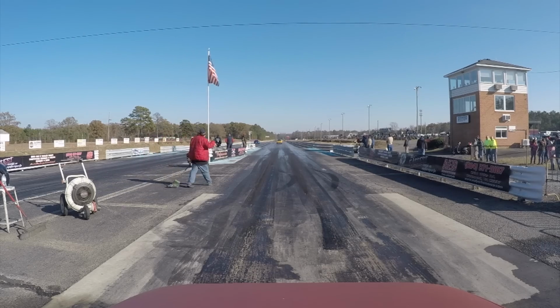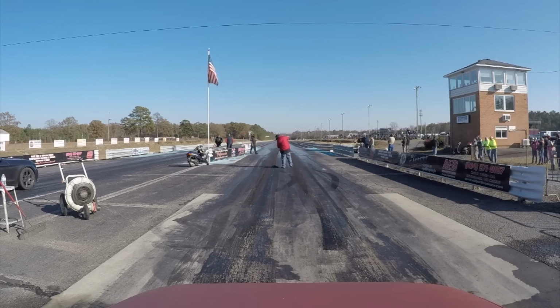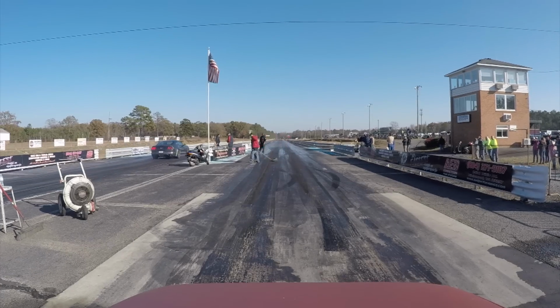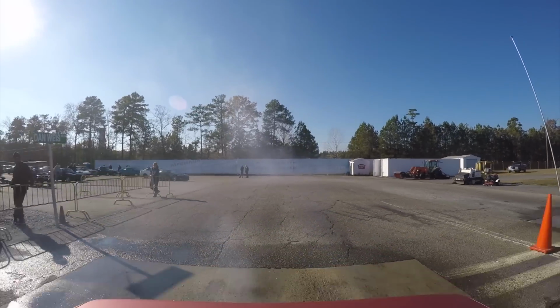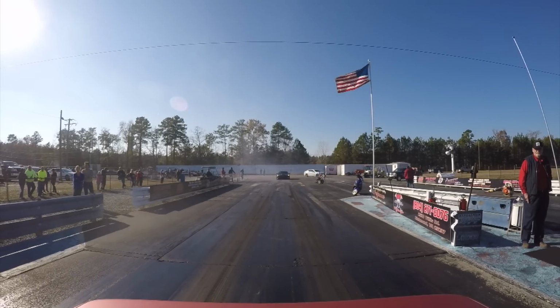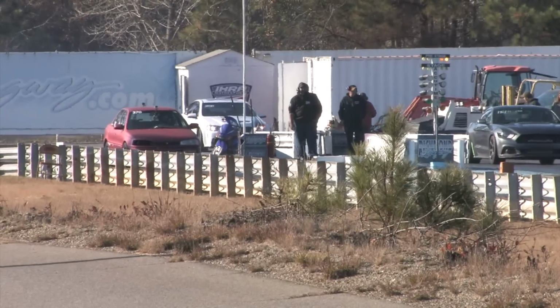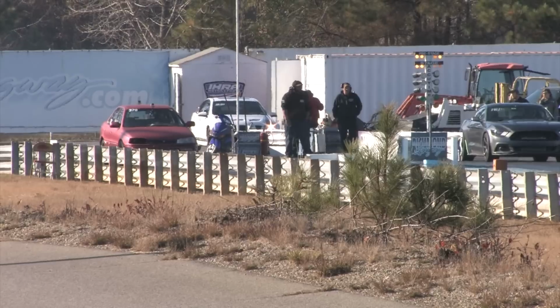Next pass. The previous burnout and run raised my right tire pressure by 4 psi, but the driver's side only went up by 1.5 pounds, so I dropped them both back down to where they were earlier when it was colder. 16 on the driver's side and 11 on the passenger. Five psi offset seemed to get both wheels participating in the burnout. I made my previous pass solo because this lane was closed for an extended period of time. Someone's car apparently leaked every bit of all of its fluids, and I hope they got the prep right because I'm using that same 4,000 RPM launch again.